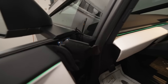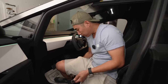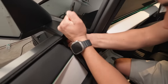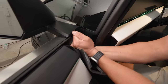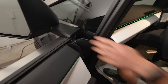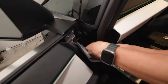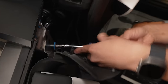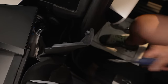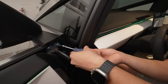We're going to go ahead and remove these. Whenever I remove mirrors I don't like using power tools, so we're going to be using a ratchet with a small nub and just loosen it up — very very gentle. Just loosening it up, that's all. Once you get it loosened up, I'm not afraid for it to come off because there are also two clips on the side holding it down, so it's not going to pop out, but I'll still be careful. These are M8 bolts and for the torx screws I'm using a T30.